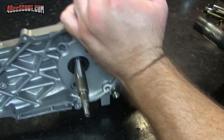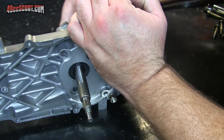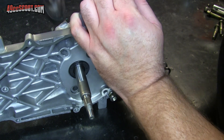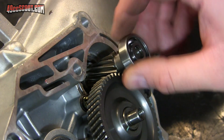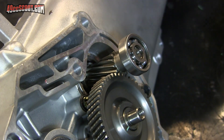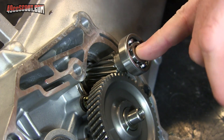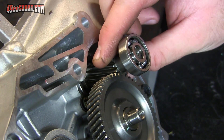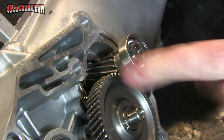It's a whole lot of fun to get a part apart when it's that tight. When I pulled this apart, the bearing actually stayed on this shaft instead of staying in the cover where it should be. So now I've got to try and get the bearing off, and then I'm going to measure this and see if maybe that shaft is oversized or something. This is the second time I've used a third support setup like this brand new, and I didn't have this kind of trouble last time, so we'll see what's up here.